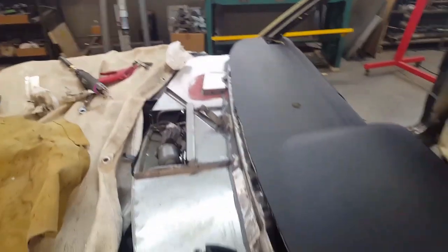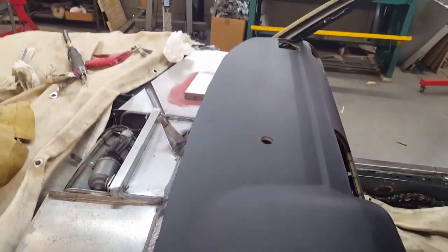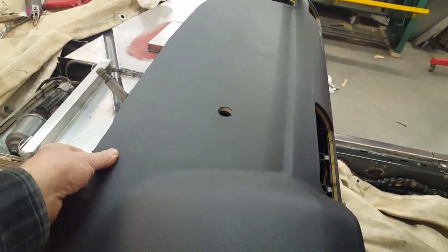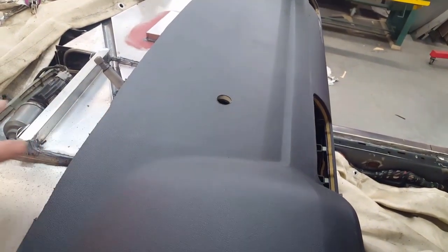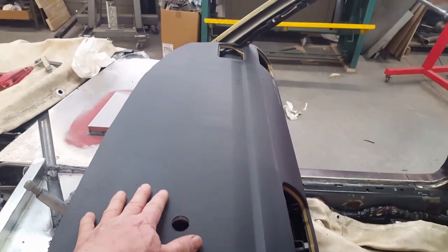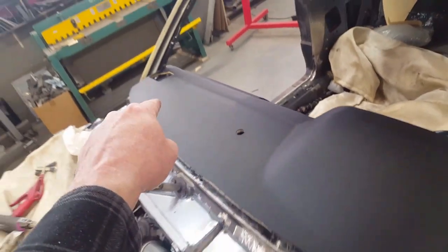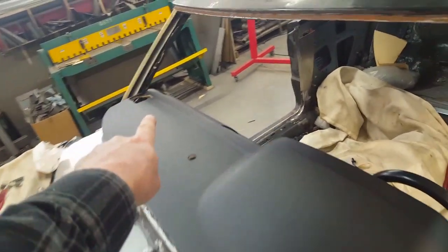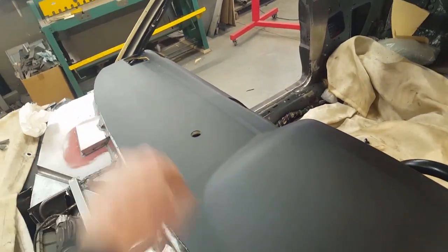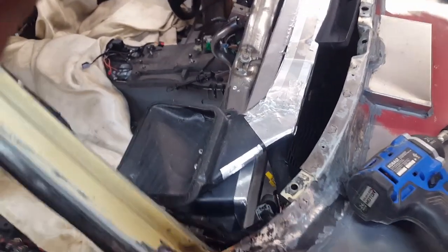I have to get the general shape right. There's some interference at the top of my ductwork over there — I thought it would be a problem, but the challenger ductwork in that location is three inches higher and this thing goes straight out to this point. As you can see it's just sitting loose, but we've got to draw it closer to the actual windshield bed. It's pretty nice all the way until the middle, then it starts ramping up because it's hitting hard on that one duct that feeds the top vent.